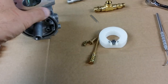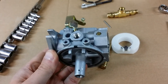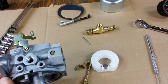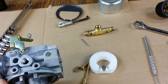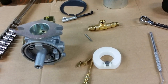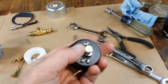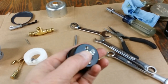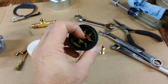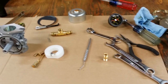So I am removing all of the sealer from the fittings and the carburetor. I think I'm going to Home Depot — that's where I got these fittings — and I'm just going to throw the old ones away and get new fittings. I've got to get that ring of sealer out of the fuel pump; I'm going to do that now. I also found a little bit of it at the base of my fuel pressure gauge, but I was able to clean that, and the gauge was working fine.